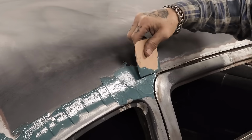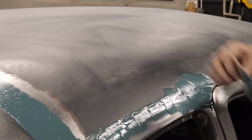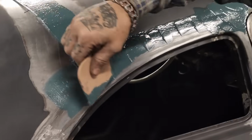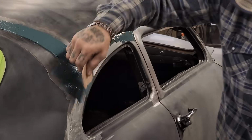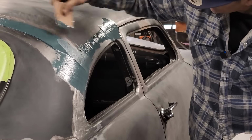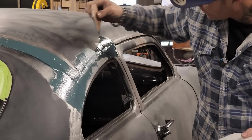Hello there, she says. All the roof has been sanded. So as you see that filler going up on top of that roof, it's been sanded. No harm, no foul. I put filler over top of paint and other materials, not lacquer primer, but I will put filler over top of paint. The reason being is it sticks. Just have to scratch it.